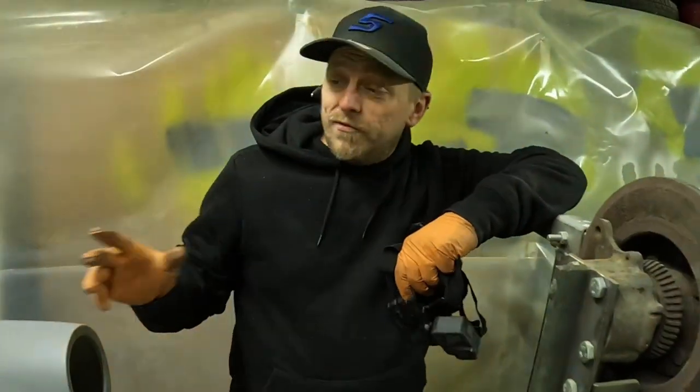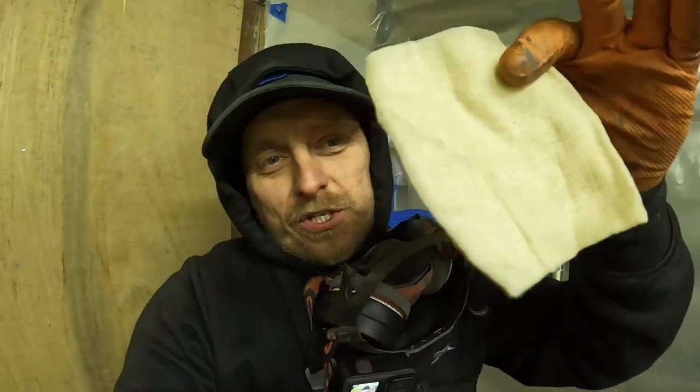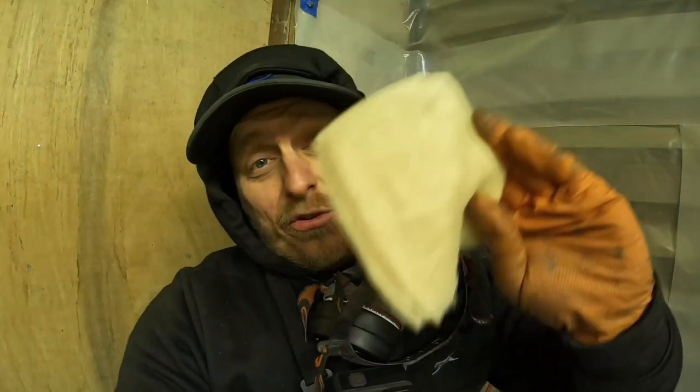As you can see, got everything hung, placed out where we want it. Everything's had a good panel wipe and a good tack rag, so I'm about to mask up and let's see if we can get a nice finish on this. So what we're doing here, folks, this is just a final tack rag down now, using these sticky tack cloths. They will be linked in the description for you as well, so if you need any of these, you can buy them, along with everything else we've used today.